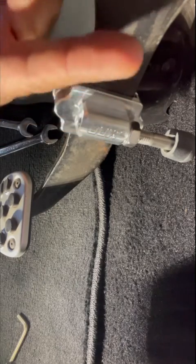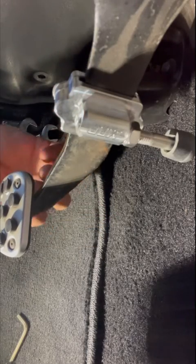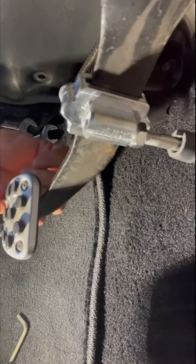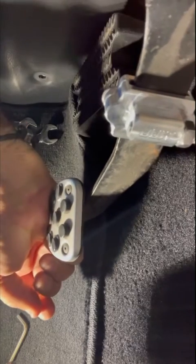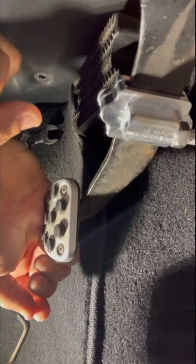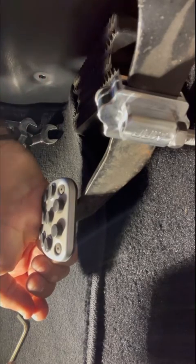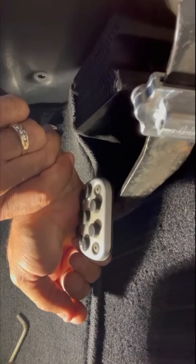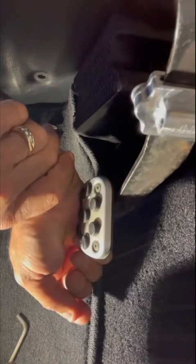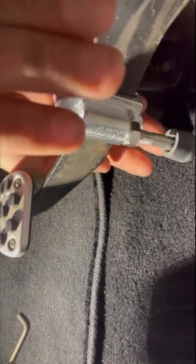That's going to damage the diaphragm and the throw-out bearing. So bring it up high and leave a little gap. Once that's set, adjust the clutch pedal to the point where it's able to go into gear — the disengagement point. From that point, you only want to travel one inch before it hits the firewall.